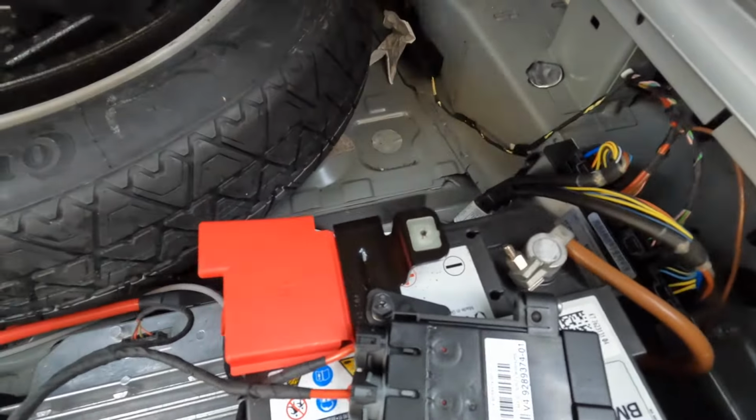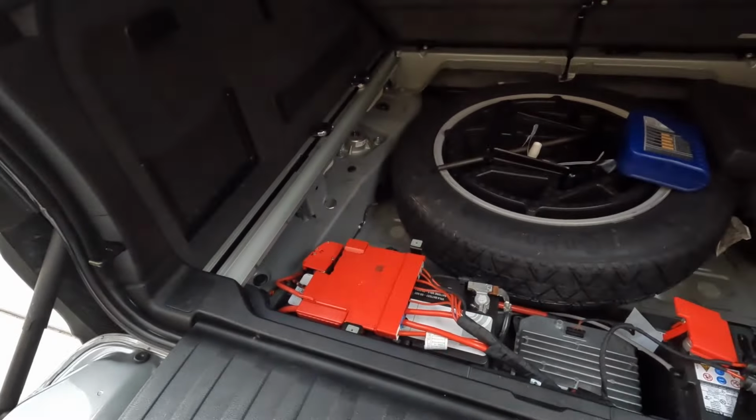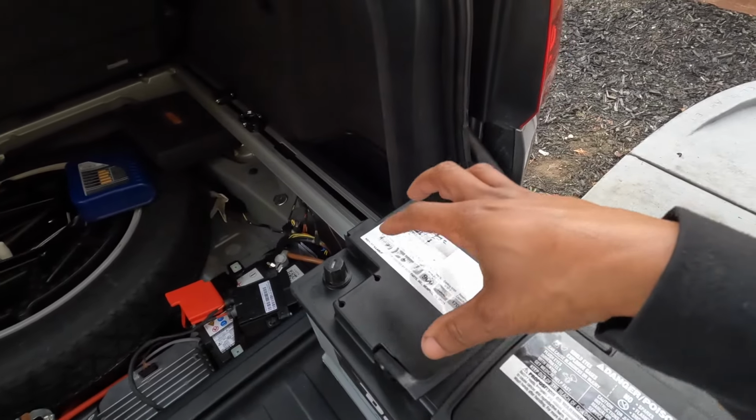Now, before you do a battery replacement, it is important you have a way to code the battery. I should say not code it, register the battery. I recommend downloading the BimmerLink app on your iOS device. With BimmerLink, you can use that coupled with a Bluetooth device. I think KIES Motorsports has one, and VeePeak obviously has one. I'll link everything in the description, what you need to register the battery. Once you register the battery, that's all it needs. Now, if I was changing from a different type of battery, with different amp hours, like this is a 95 amp hour battery, and I believe what's in here is 92 amp hour. If I wanted to go up to like 105, I would have to code the battery as well as register it. And with coding it, you have to go through BimmerCode.